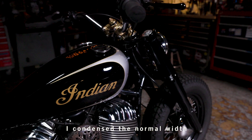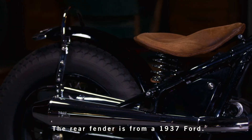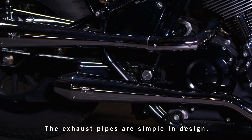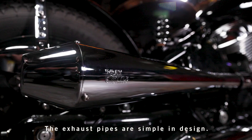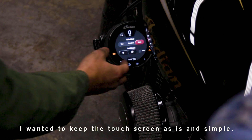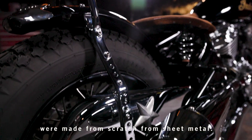The height of the gas tank was lowered 2 inches. The height of the mount was set slightly lower. The rear fender was brought in from a 1937 Ford style. I made the mount and set it up to the frame and the tire. The exhaust pipe was very simple — the megaphone back is called a Bloodshot style. The last one is chrome. The speedometer was good; it was easy to remove, but I wanted to keep it. I made a mount and left it. The covers and chain guards are made from scratch.